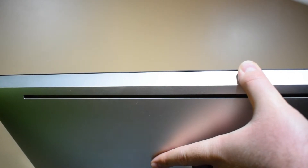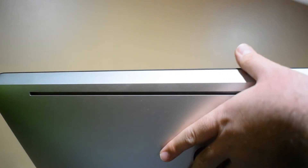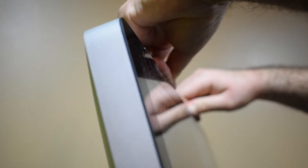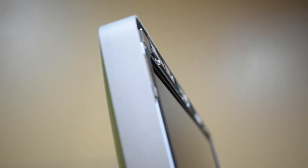The first step is taking the glass layer off the iMac. The right way is using two suction cups to lift the glass — magnets hold it down so that works best. I don't recommend doing what I'm doing because you can crack your glass. Since this machine has been taken apart so many times, I can just peel it off with my fingers, or you can use a credit card or a thin piece of plastic. Once that's off, you get into the screws, which are Torx bits — T10s I believe.